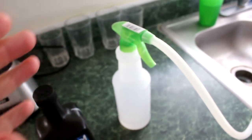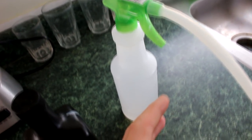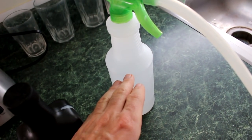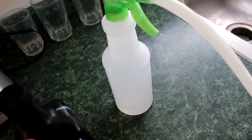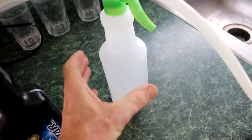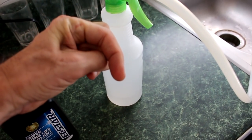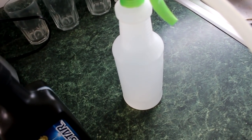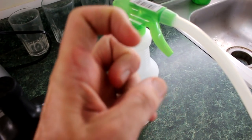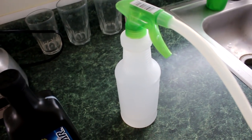What you're going to do is get yourself a wash bottle. A wash bottle is about half the size of this one — it's used a lot in chemical labs or industries that use acetone. It's basically a little bottle with a cap on top and a straw that comes up and hooks. If you want to get one online, just look for a wash bottle. It'll have a stiff straw that comes up and hooks — those are perfect for adding coolant to the motorcycle.